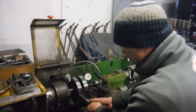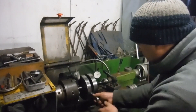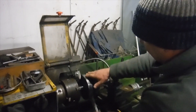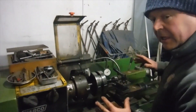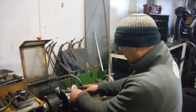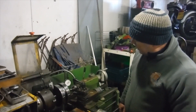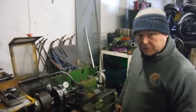When I get those figures I know it's going to be all right, because I'm told the engine ran nice and smoothly with this crank assembly in it with that sort of runout. It was only the big end itself wearing out that necessitated the engine strip. So what I'm going to do next is take this crank assembly out of the lathe, split it, change the big end, put it back together, and try and true it to figures like you see there.